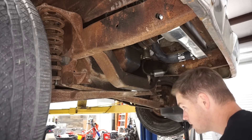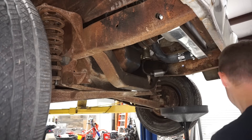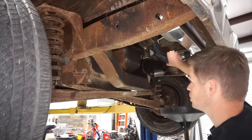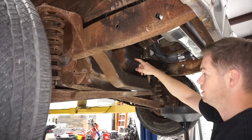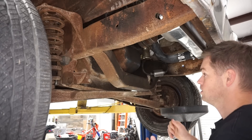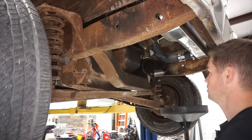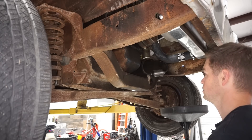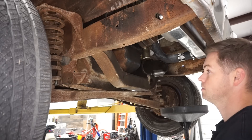The first thing we've got to do is get some fluids out of this thing and do the groundwork, starting at the bottom. I'll pull the radiator fluid out of here. You can drain the oil if you want to, but I'm just going to leave the oil in it since I'm going to put the motor on the stand anyway. The transmission and engine are going to stay together, so I'm going to pull the driveshaft out, pull the bolts loose out of the transmission motor mount, the rear motor mount, and then break loose the two front motor mounts.